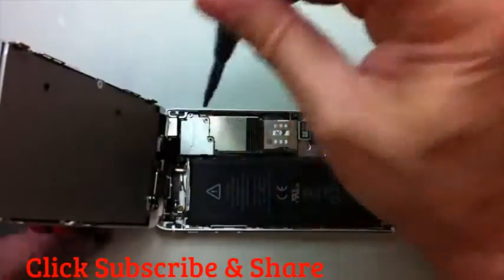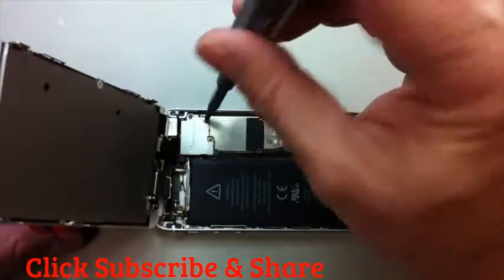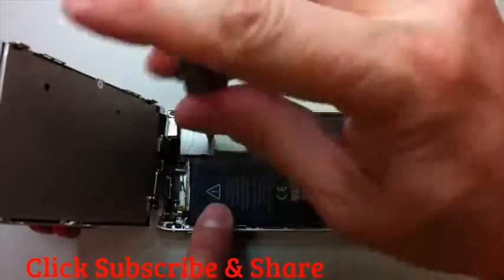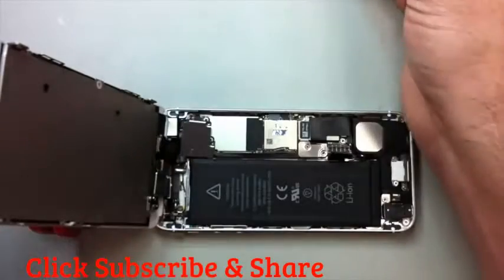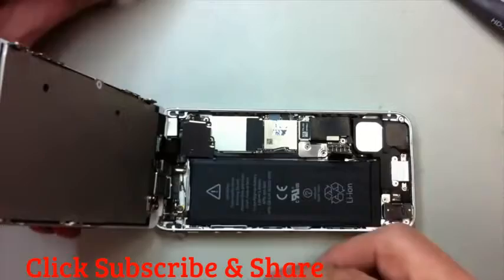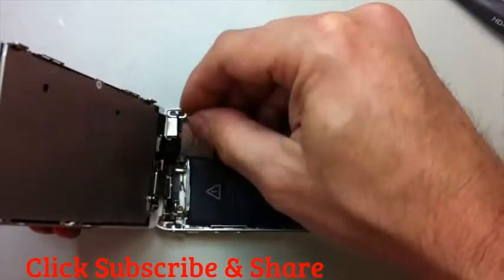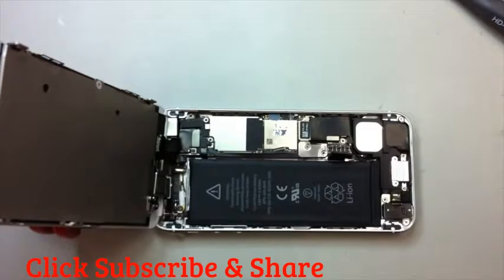Up here we have three additional screws that hold the plate in, which covers the LCD digitizer and front-facing camera connectors. So we'll take these three out. You'll notice that the one on the top left-hand corner of the phone that we're looking at, it is not magnetic, so it went flying across the mat here. So you're gonna have to keep an eye out for that. It will not stick to your screwdriver.